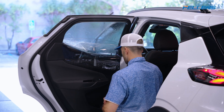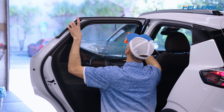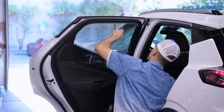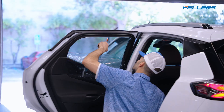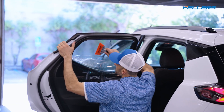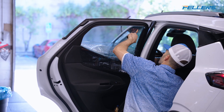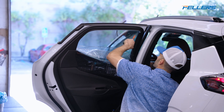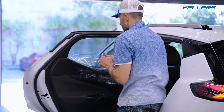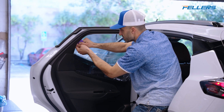Now I'm going to use my TrueSpray system to wet the top, and I'm going to use a pulling motion for my first couple of swipes. Once I feel it start to stick, I can switch to pushing the squeegee — pushing just means my hand is behind the squeegee rather than in front. I'll go over it until I feel like it's not sliding anymore. Notice how I'm staying away from the sides with my Fusion squeegee, because I don't want to ram it back there and crinkle the film. We stop about a half inch from the sides. Then I grab a tri-edge hard card and go up — I need just enough to be able to roll the window up.